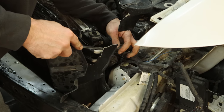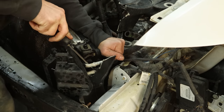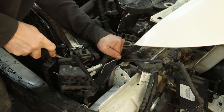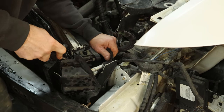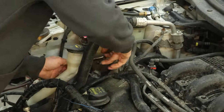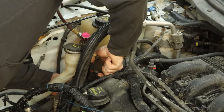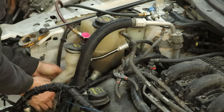Looks like it transferred today. We'll get to that lower hose and see if we're getting trans fluid or blood out of this one. These things do not like to give up — there we go, just trans fluid this time. This is certainly inconvenient. I know I could walk across the shop and go get the spring clamp tool, but I'm lazy, so I'm just going to complain. We'll disconnect this from the overflow bottle. Pretty much all the hoses stay with the radiator except for the transcooler lines.